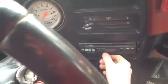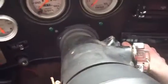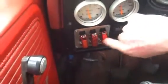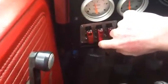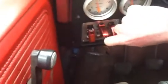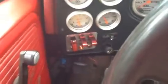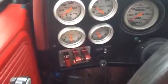So we turn that on. Let's get this thing. So what I did over here is cold advance for the injection pump, glow plugs, high idle. Since it's kind of chilly today, we'll do the glow plugs first. We'll let them run for about a 10 to 12 count. They are the 60 Gs, which are supposedly self-limiting, so hopefully that works.